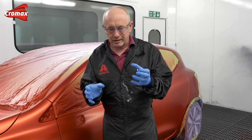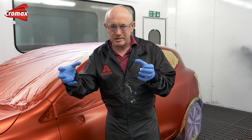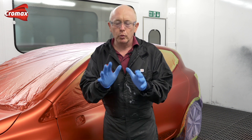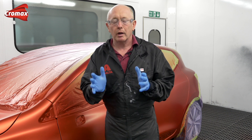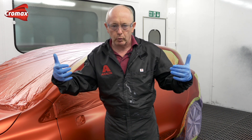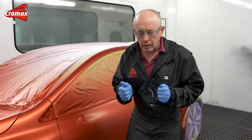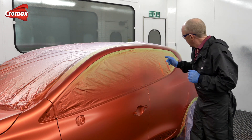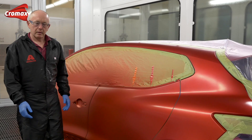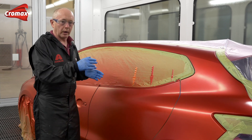With regards to adjusting the tinted clear, at the same time adjust your untinted clear, use the same speed of adjustment, and I would always suggest using a slower adjustment. The reason is that you want to give yourself enough time to bring the two together in a closed, uniform film. Take a pair of identical spray guns and you're ready to go. That was a little bit on the general application rules that you need to follow as you're applying the tinted clear.